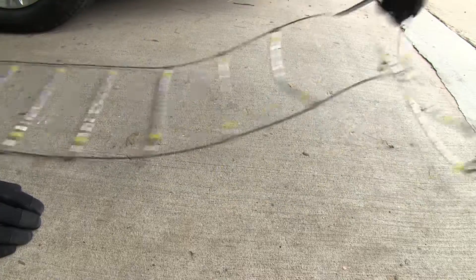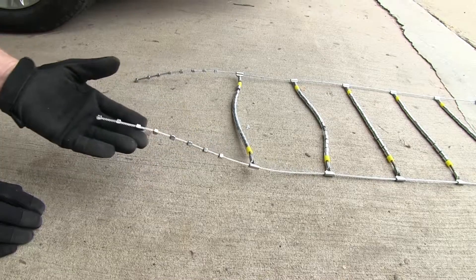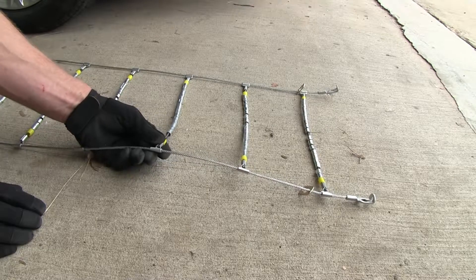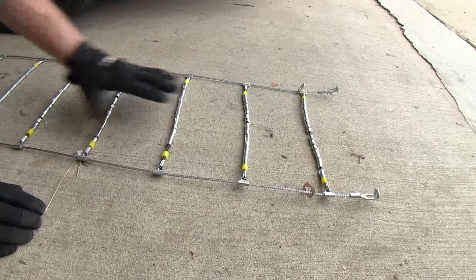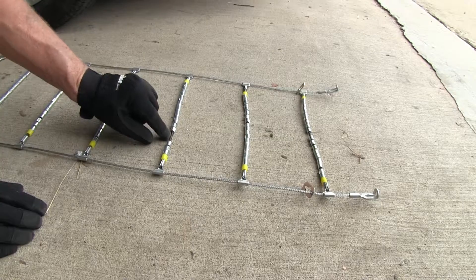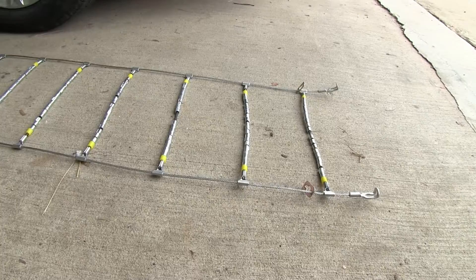Running to the other side of the chain, the cables with the stops on it always go towards the back of the vehicle when installed. This is a cable-style chain with a ladder-style pattern on the tire. It has rollers on top of a coil-wrapped cable, and these will move around as needed to get grip on the ice and snow.